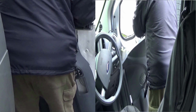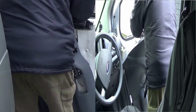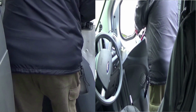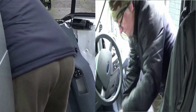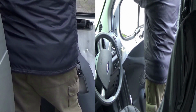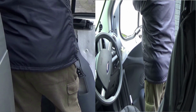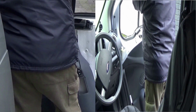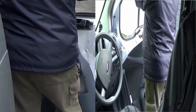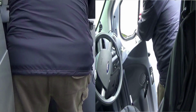Right, this next section of the job, as you can see if you look at both sides, has a lot of cleaning up to be done. There's broken glass in there and you've got to get every tiny little shard of it out, because otherwise it'll stop you from getting the new piece of glass in nice and snugly, and make sure that all the holes line up at the end of it. The holes in the upright bar, which you can see just underneath on the right-hand side, that little bar that goes up, is held solid with a bolt at the top. That will not line up if you have any pieces of glass left in that rubber. So the rubber around the little quarterlight window has to be absolutely spotless.